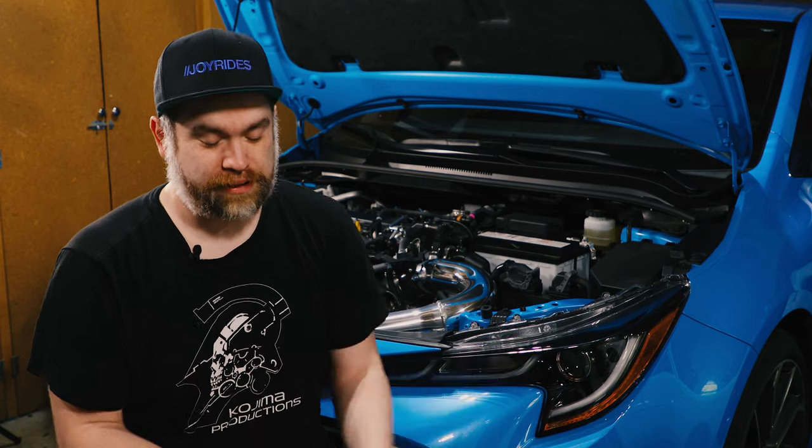I ended up getting a check engine light that the engine was running a little lean, and I took it into Toyota and they were like, yeah, your MAF is broken. You need to order a new one. That was about $180. So don't make that mistake.